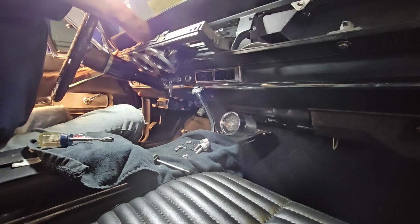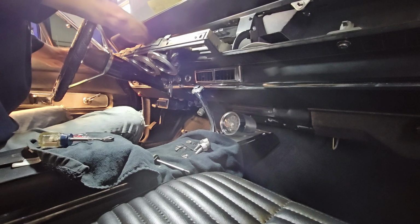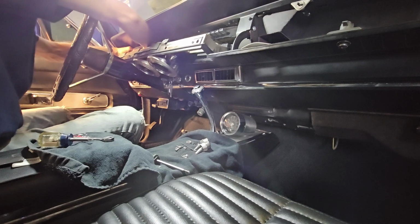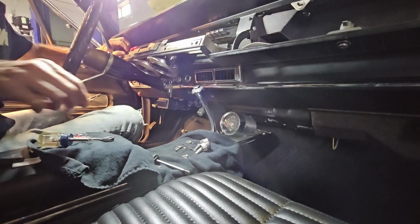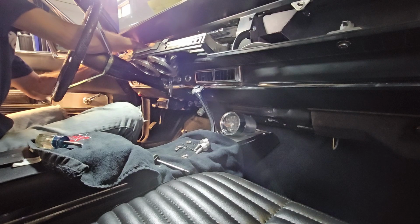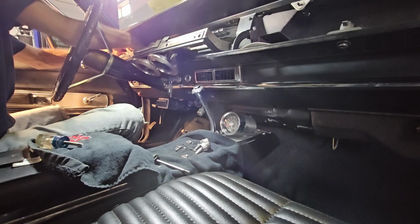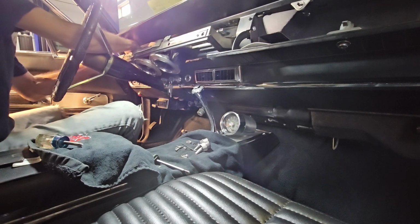The 5-volt signal wire. That 5 volt is what feeds the coolant gauge and oil pressure gauge. Then you unhook the black wire with the white tracer. That's your 12 volts from your harness to your cluster. And this is why you want to have your battery disconnected, because now you're going to take off the amp gauge wires. You just need a 3/8 wrench. Quick pop those nuts loose. Take off the black amp gauge wire and the red one, doesn't matter in what order you do it.